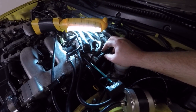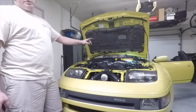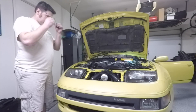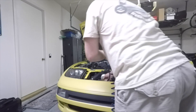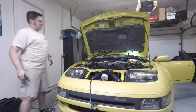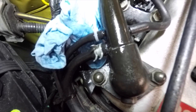I'm going to try patching that up and then see if there are any more leaks. That large vacuum hose goes off to the booster, and it turns out it is completely hard and ruined with flat teeth. So I've capped it. Now let's see if I still have an intake leak. I'm looking at the crossover too — you can see the bubbling there. Even with the clamp, it has basically failed or the rubber has shrunk.